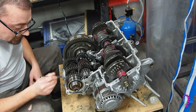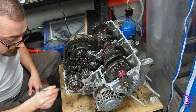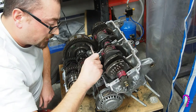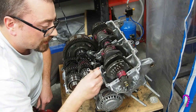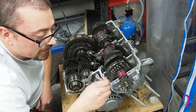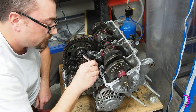And if you watched the last episode, you know we had a little bit of a problem getting the crankcase together the first time we tried it. It's a problem entirely of our own creation, just forgot to put the alignment pins in when we assembled the crankcase halves, which meant basically a redo. But we're not bitter. We're back at it again today. And I think we're gonna have a much better result.